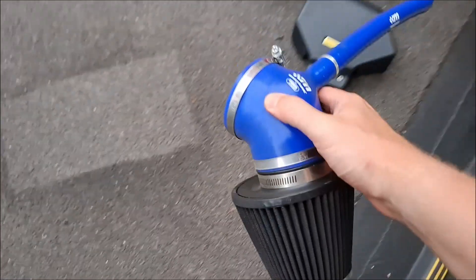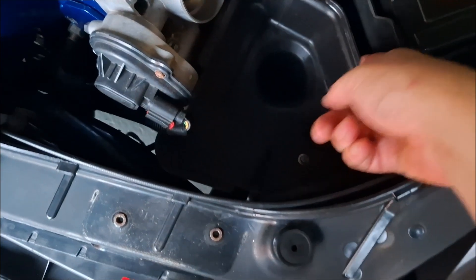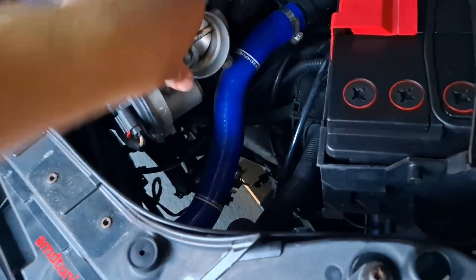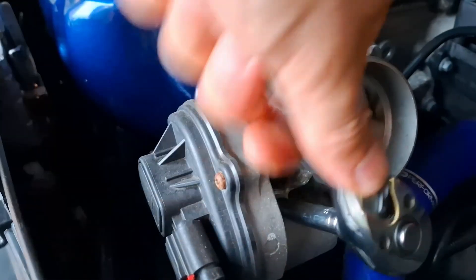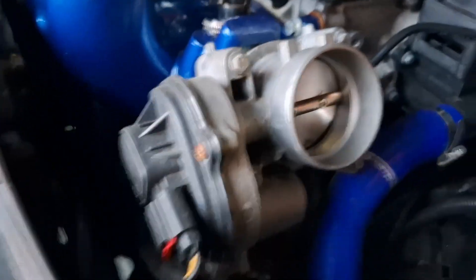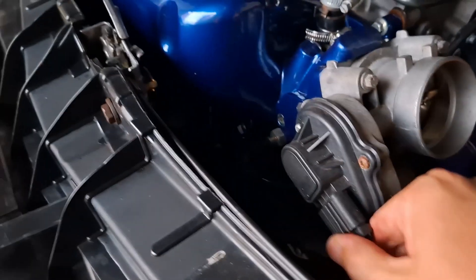It's all about creating access so you can get that manifold out, pulling it forward into one side. So now we need to go after the bottom half of the air box, secured by a single bolt, and now we're on to the throttle body - four bolts around the outside and the clip there for the throttle control sensor. Pop that off and away it comes.